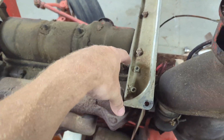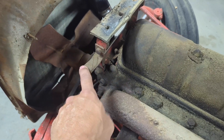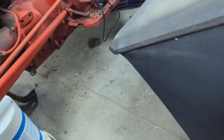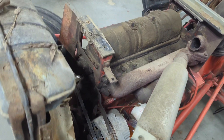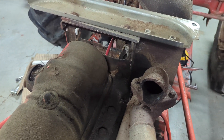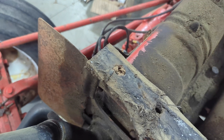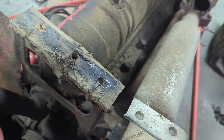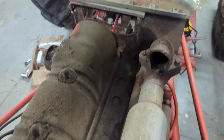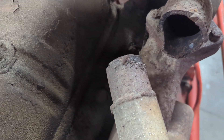The tank's missing a plate — there's normally a plate that goes across here, at least on the 600, and I imagine that's what these holes are for. This bracket is different; it looks like the exhaust was actually bolted with the gas tank on there, so it basically just flopped off when I pulled this off. This looks like it was homemade — just no clamp and they're stuck in there. That neck is actually broken; I'm going to get another one of those. It was actually inserted up in the tank, and I think it was just loosely in there. We'll see about getting a new exhaust elbow.